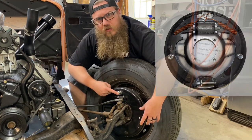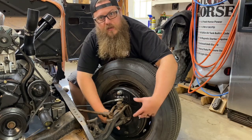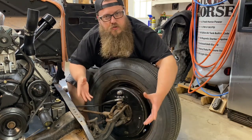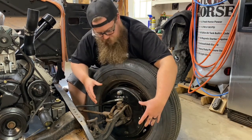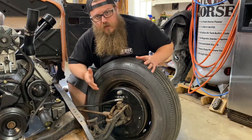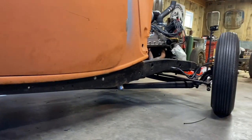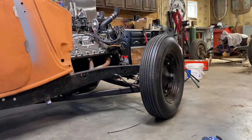We can center the whole assembly here. It has a normal adjuster on the bottom, like a normal drum brake — just one turn of a screwdriver and you adjust the shoes out. Very easy, very simple. Great install. We put them on round-back spindles, and they can go round-back, square-back — a couple different spindle options for this backing plate. Then we put the 39Y5 hubs on it with brand-new wheel bearings, the works. So this should be a really great modern-style stopping setup.